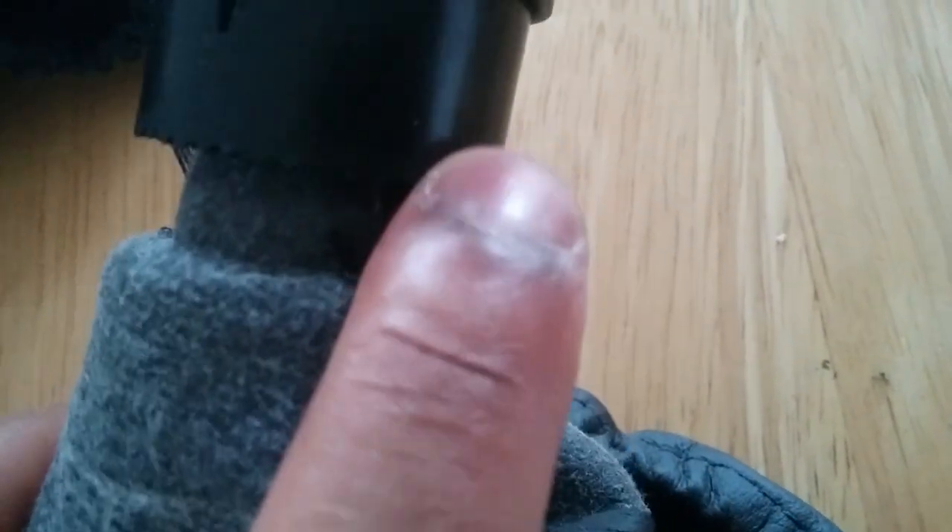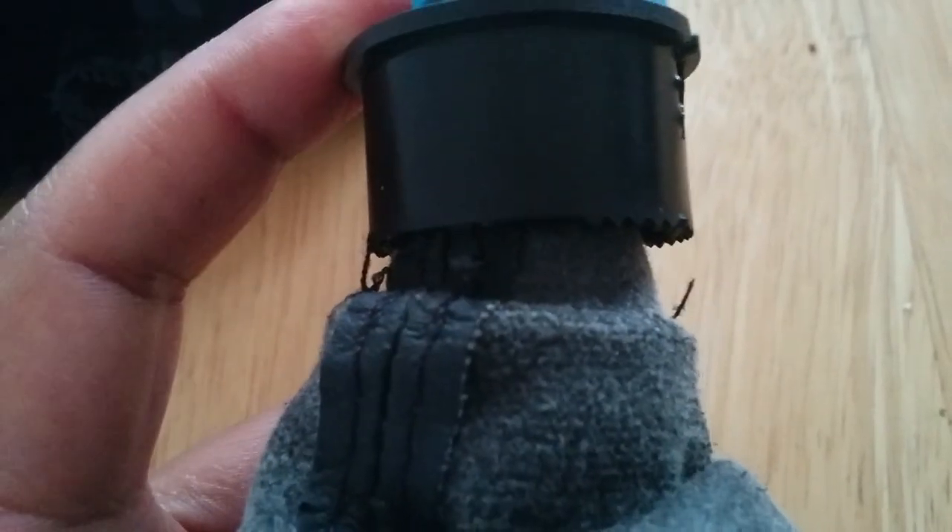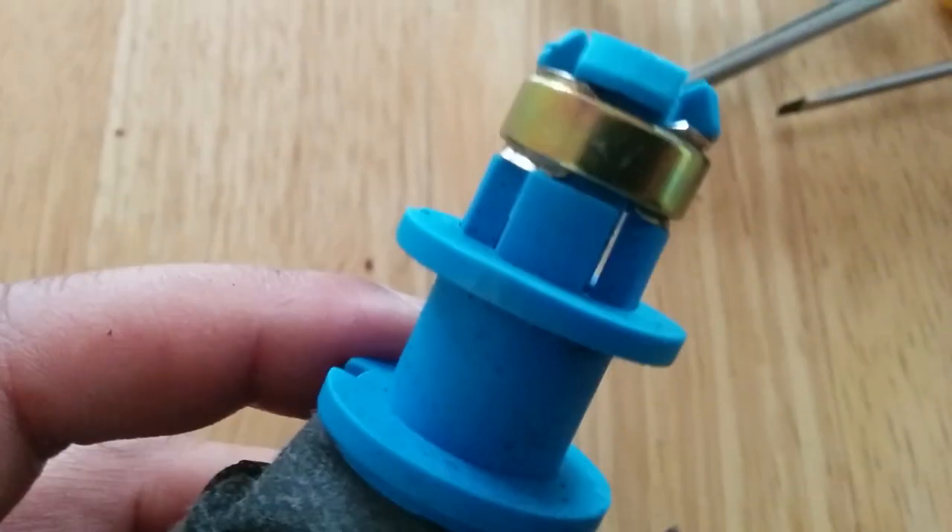I went round the edge and you can see how you put the top of the gaiter inside out underneath that, and it's sliding freely. So I just have to feed the top of the new gaiter in upside down and then press this back. You do have to take this off — it's too slim to get over the actual knob itself — so you take it over the blue housing here.